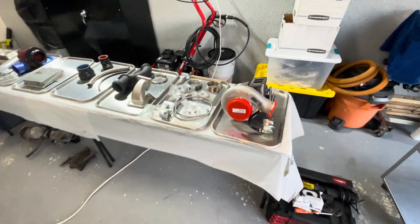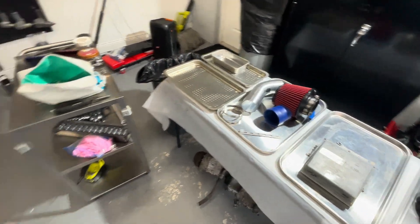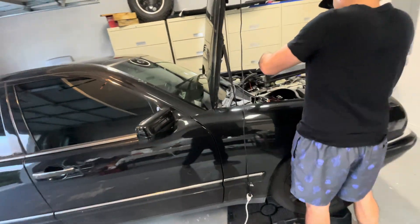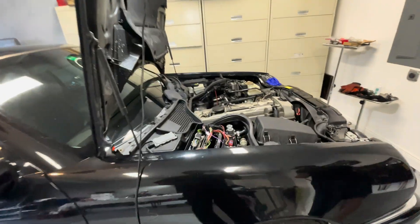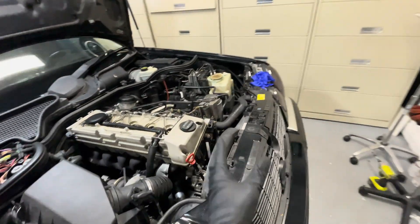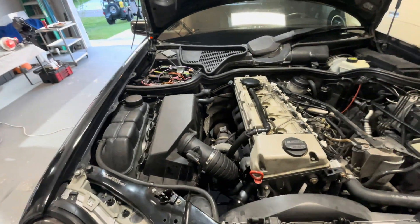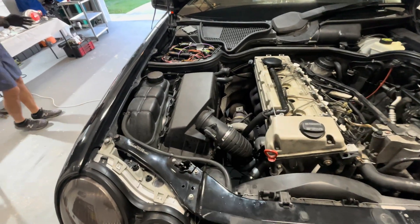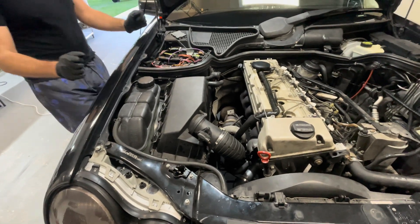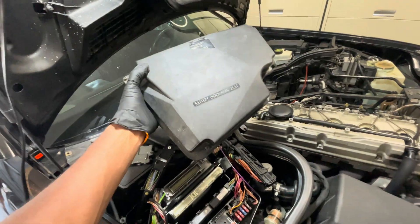Alright, so these are components for the kit this car is going on. Currently just going to swap the ECU out first and go from there. The intake manifold is already off — that's not necessary, but more or less it's off so we're just working on this side for now. First thing was the ECU — getting the box off, it's just four screws at each corner.